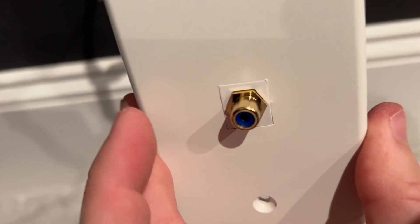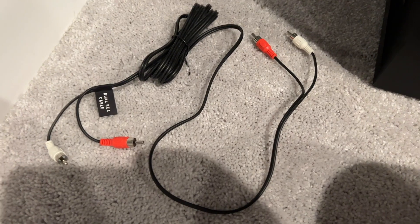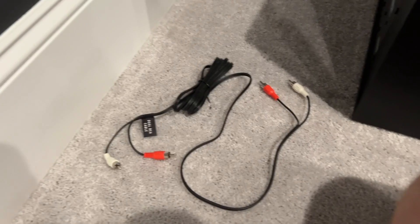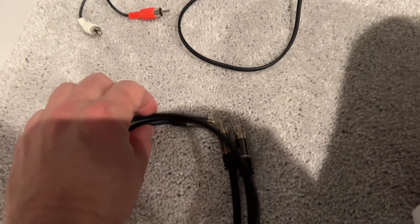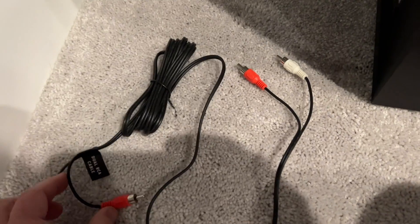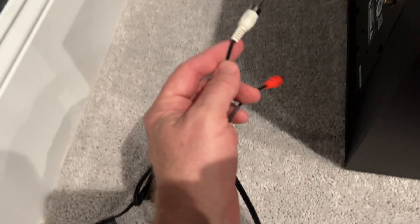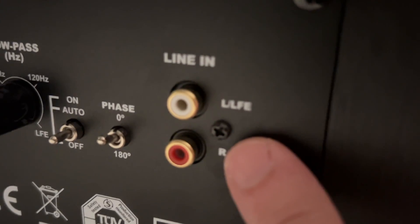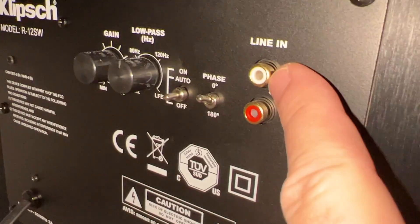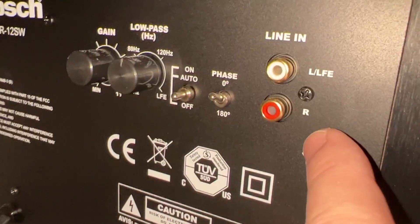One side coming out of the T terminates to a connector that has a keystone screwing onto the RG6, and then we have an RCA connector on the other side to connect the sub. The second piece of the upgrade is I'm going to replace this normal RCA cable with an RCA splitter — an RCA Y cable. It has one male end on one side and splits into two. Before, I was just plugging the white one into my wall and into the white terminal, which is the L or LFE. If you're only using one line, that's the one you're supposed to use.